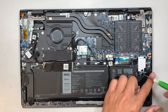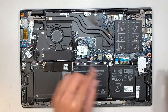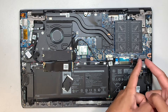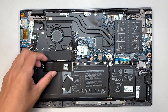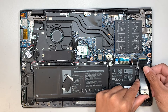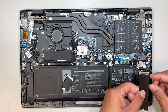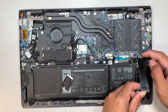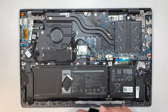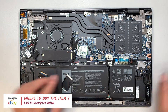Here is the secondary slot — remove that one screw, slide the cover up, and you can see the additional slot for M.2 storage. However, you're not allowed to have the full-size M.2 installed here because there won't be enough room. You can buy the smaller mini M.2 and slot it in. I'll link them in the description below — you can find them on Amazon or eBay.